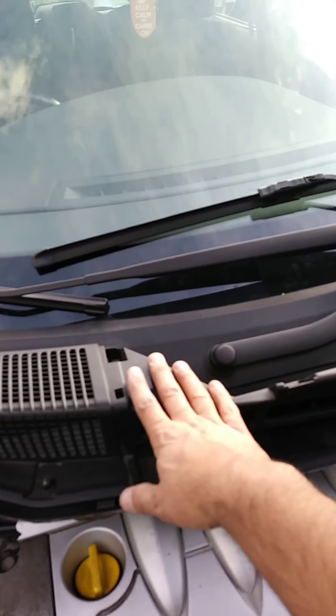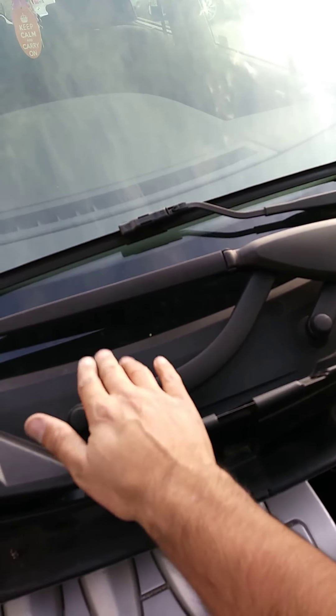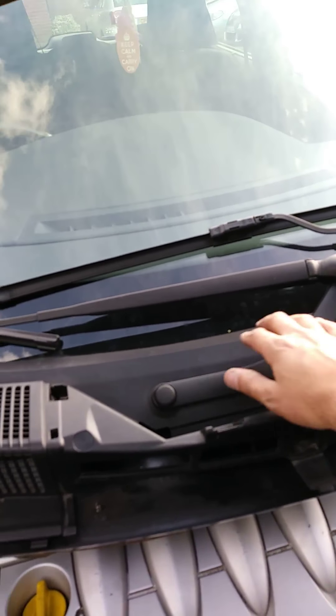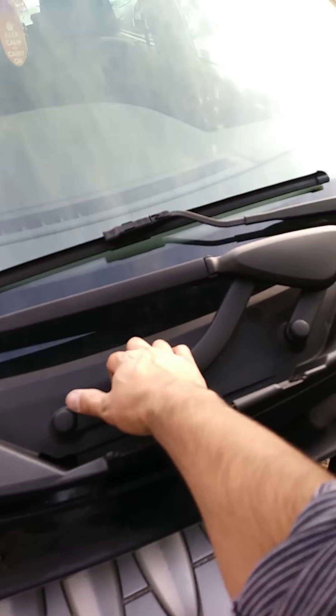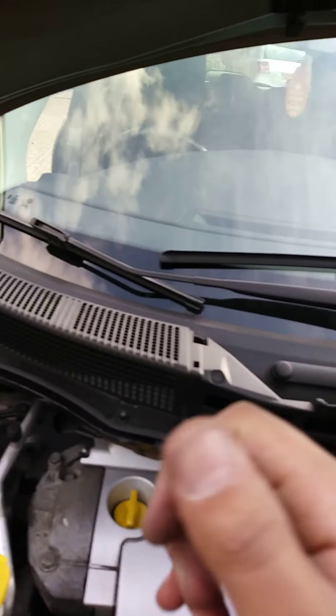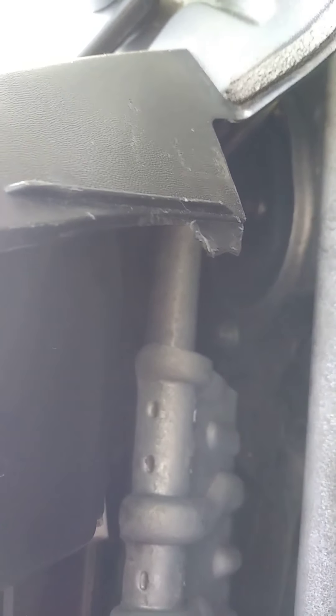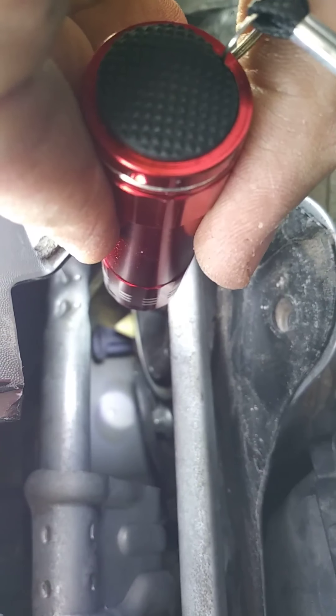Removing this panel can only be done if you remove the windscreen wipers from all three sides. You can put some WD-40 on there if they don't come off — it's a bit of effort, just keep pulling on it. There should be tubes on the side which are for the scuttle drainage. I'll show you in a minute — I'll see if I can identify them on camera.